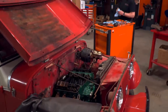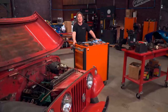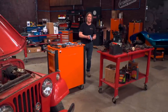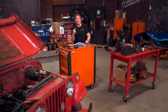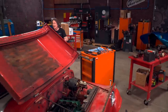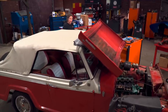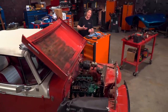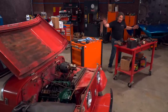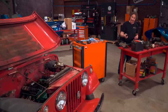Welcome back to Gears, where you can see we're up to our elbows in a Level 1 restoration on a '67 Jeepster with just a hair over 8,000 miles on it. I know some of you are probably thinking that's a lot of stuff — I thought a Level 1 was easier than that. A Level 1 is get it running and driving safely, which is a lot more involved than just pouring gas down it and trying to start the engine. We're not messing with the paint, not doing anything with the top, the interior, no fabrication — none of that. That all comes in Levels 2, 3, 4, and 5. A Level 1 is all mechanical: fuel system, electrical, cooling system, brakes, suspension. So as you can see, we pulled off everything that's old and crusty that either needs to be replaced or rebuilt, including the intake and the valve covers to replace the gaskets.